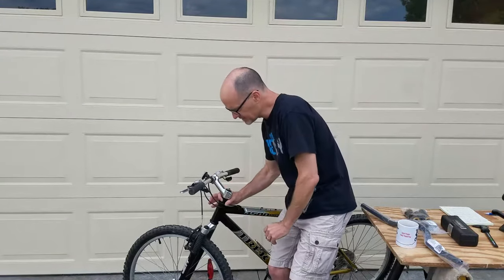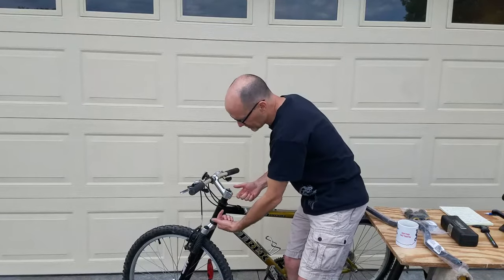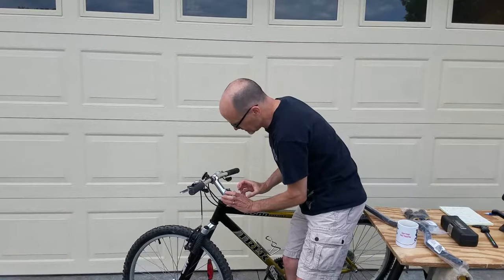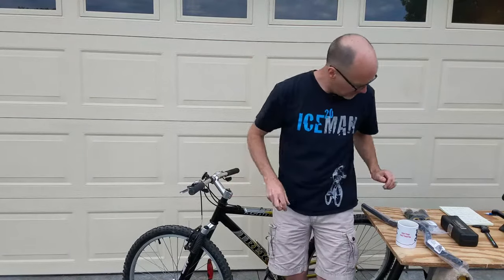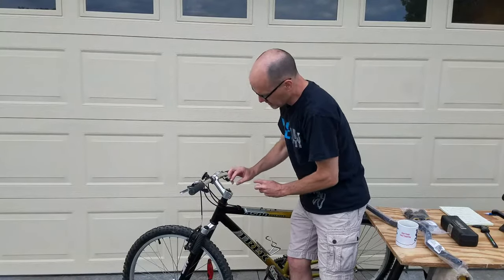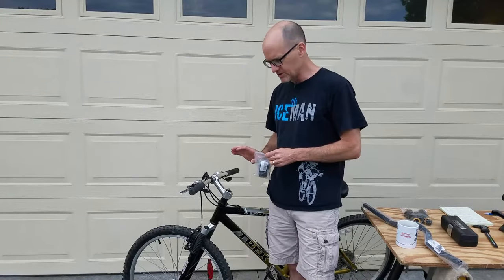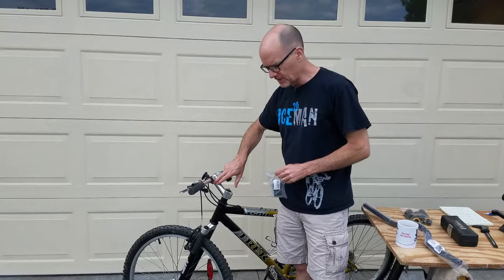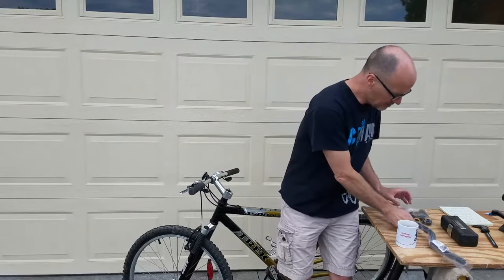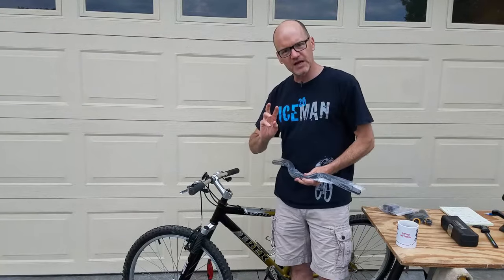More recently in higher end mountain bikes, in order to get a bigger diameter of what's called the steering tube or the steer tube, that's part of the fork. It's the tube that comes up that the stem clamps onto. So in that type of assembly, you'll put a separate piece at the stem, and part of the change that we're doing to this bike is to reduce stem length, shorten it, and then raise the handlebars. So that's the two different styles of stems.